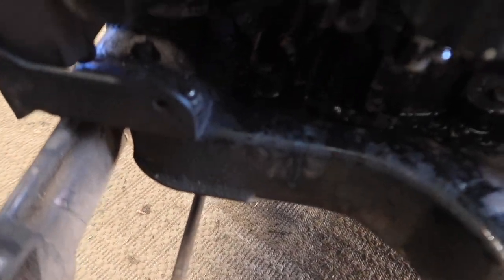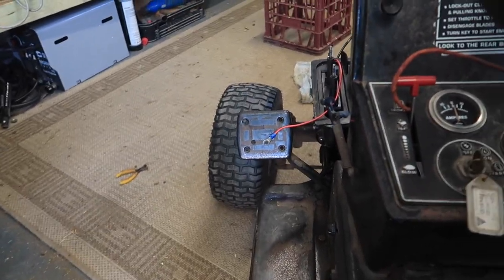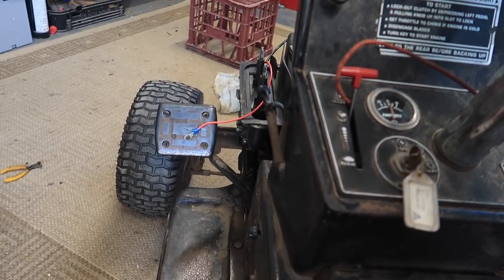Can't say much about the brakes. When you get to a certain RPM it burns oil — have a look at this. All that down there — once you rev it up a bit too high it's just white smoke and oil everywhere. I don't know if that's coming from the blowby or leaking past the pistons — no idea.